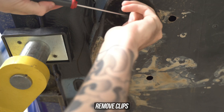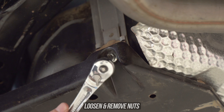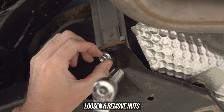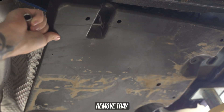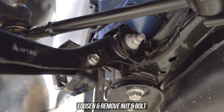First step is to remove the under tray so that you actually have access to remove the traction arm. Pop off the handy-dandy clips on both sides of the tray, then whip off those two 10mm nuts and lower the tray on down. Pro tip: do not leave your mouth open as there are more than likely rocks and dust from all those times you totally didn't go off the track in your 86.